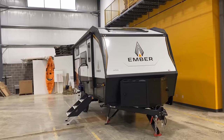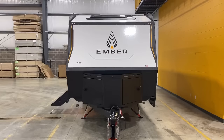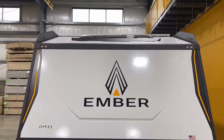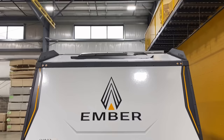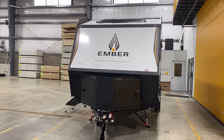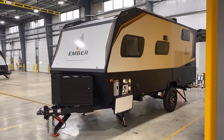These are seven-and-a-half feet wide — not a full standard body. They are an all-composite body: walls are aluminum packed with block foam inside and out, the roof is basically a wall that is twice as thick, and the floor uses a completely different composite material, very similar to what Airstream uses, only twice as thick, for extra strength. I like how they put that little wind fairing over the Stargazer Skylight up front. Some people asked: what if you leave that unlocked going down the road? Well, that's just a pre- and post-trip checklist responsibility.